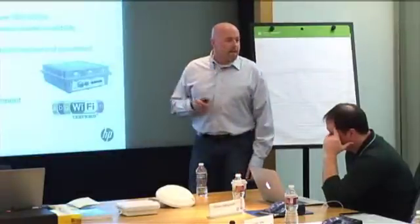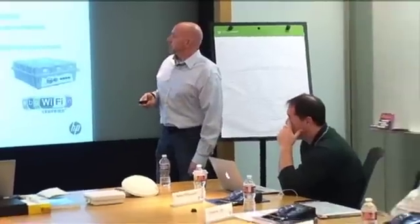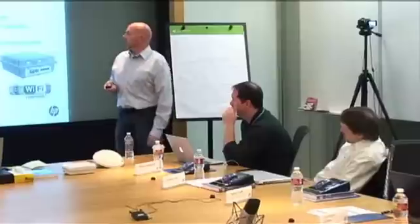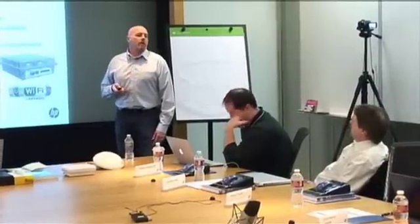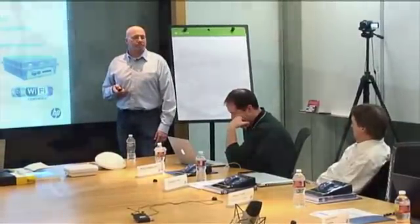Just a thing about that previous one, the near gigabit Ethernet WLAN client access. Technically, if you think about even running 3 streams on the AP, you can't get near gigabit speeds with 2.4 gigahertz. You'd have to run them both with 5 gigahertz radios, and you get interference. I mean, it's a bit of a stretch. It depends how you look at it.